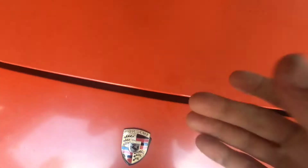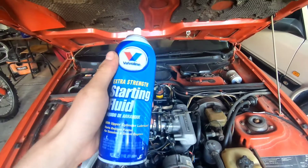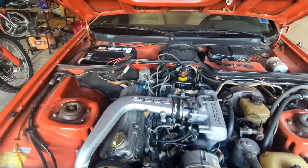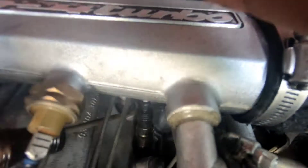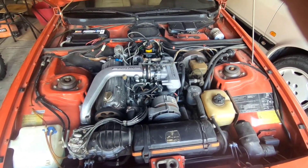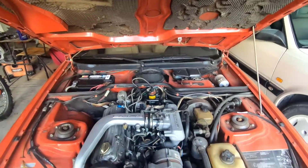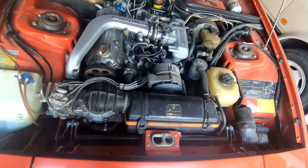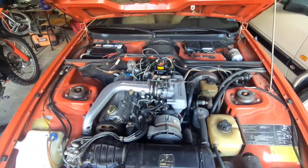In order to test this, it's a very simple test. All I'm going to do is take some starting fluid, start the car up, let it idle, and then aim the starting fluid at this gasket here at each one of these intake manifold ports. In theory, what I'm listening for, if there is an intake manifold gasket leak, is a change in engine pitch when I spray the fluid on there. The starting fluid is more easily combustible than fuel, which should create some sort of effect on the engine — most likely it'll rev up and run a little cleaner since it's idling rough.